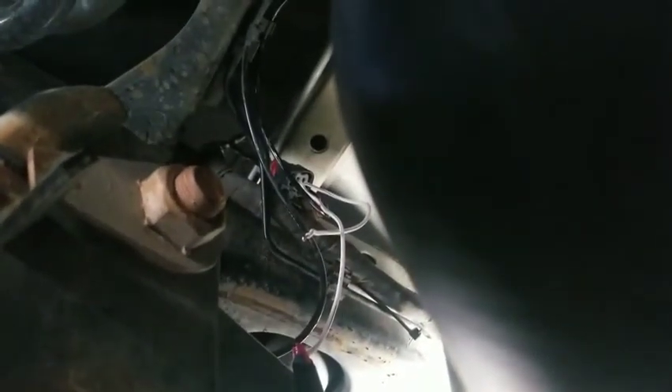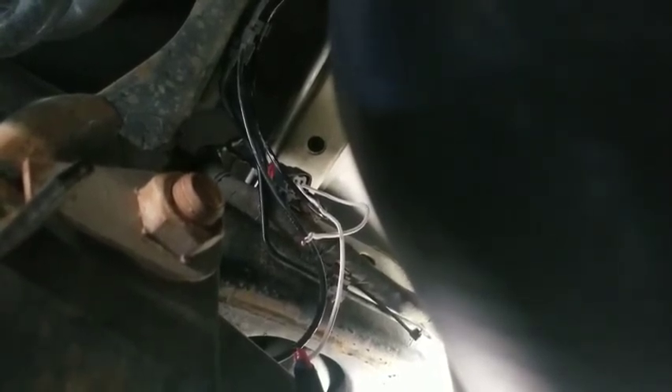We've located the other plug for the left rear wheel sensor further up the vehicle. With our ohmmeter set to ohms — actually with the continuity beep — I put a couple of leads coming out of the plug going back to the wiring harness. With the jumper wire bridging those two wires at the far end, we now have a completed circuit. Testing it with the meter — it beeps. We know that's a completed circuit, confirming both wires are continuous from this point all the way back.